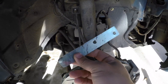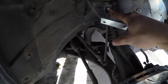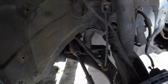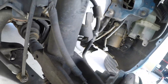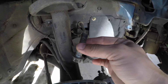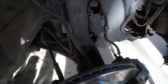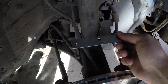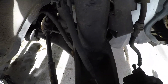Here's where our fancy little piece of metal comes into play. I'm going to lift up on this whole assembly so that I get a little bit of slack, push that out of place, and then struggle with this little connection. This piece is pinching onto the strut. What I need to do is feed the bolt that I just took out of it through it — but going the other way — and stick this little piece of metal in before it hits the opening, and that's just going to force this little knuckle to spread open just enough so that we get a gap.